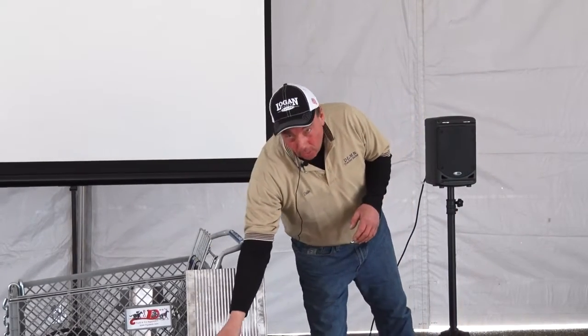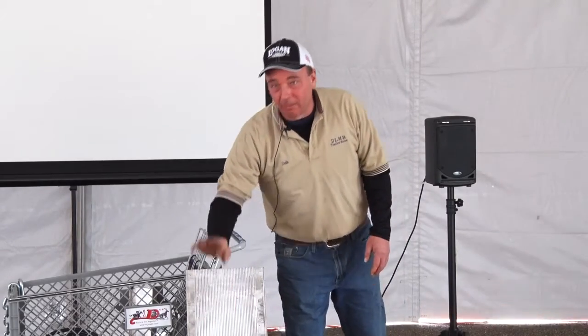So floors are a big thing. The reason the wood does not rot out, one, there's gaps. So when the horse urinates, it goes down on the ground. Plus, when you're driving down the road, the air's turbulating and drying out underneath the floor. That's why these do not rot out. I've done one of these in my whole career.